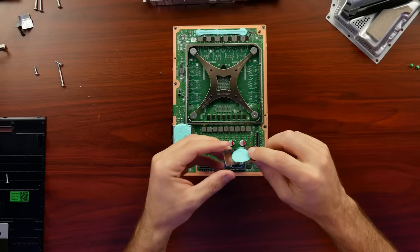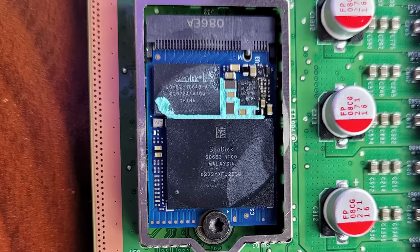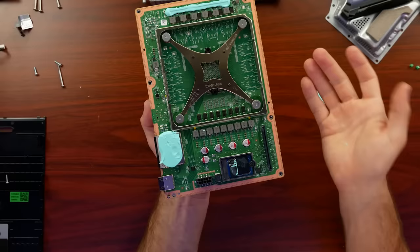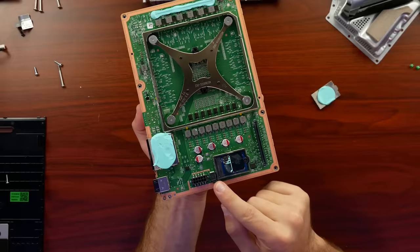Let's go ahead and take a look at the SSD. They do have thermal padding underneath there as well — they're making sure that the SSD does not overheat at all. Some of it actually spilled over, but it's not a big deal and it won't harm it. It is indeed removable — it is socketed in. Looks like we just have a Torx screw here and it lifts up. It looks like a typical M.2 drive. I'm sure Microsoft has their own proprietary partitions set up like they did with the Xbox One, but it's good to know that if the SSD does fail, it is replaceable at least at a factory level.